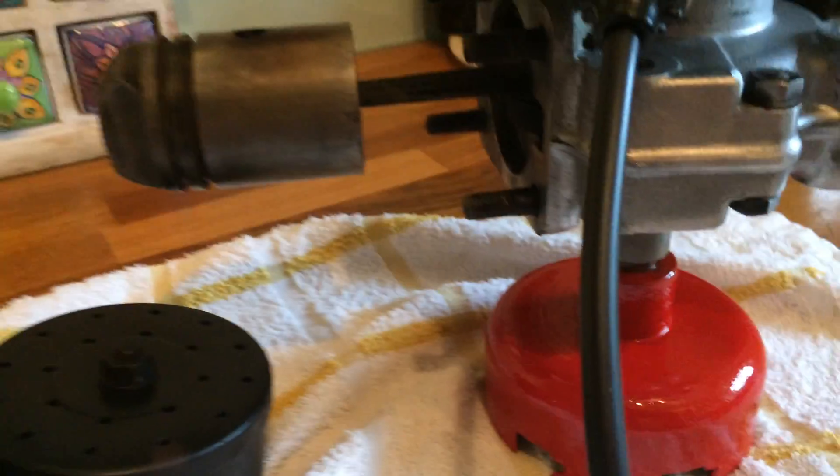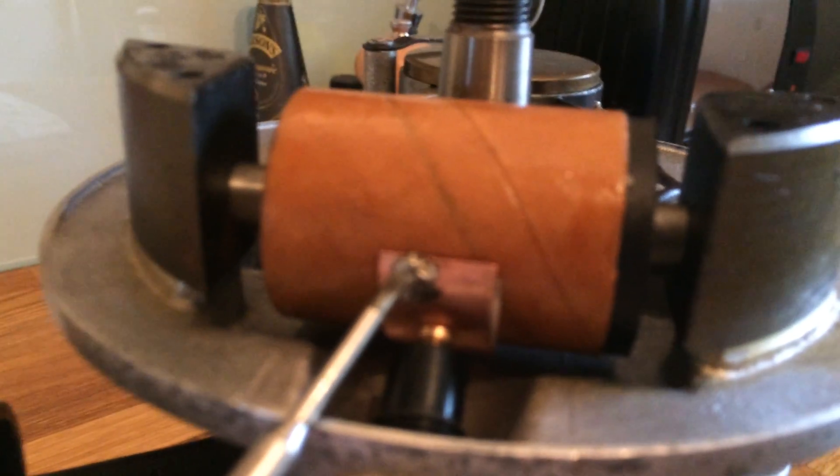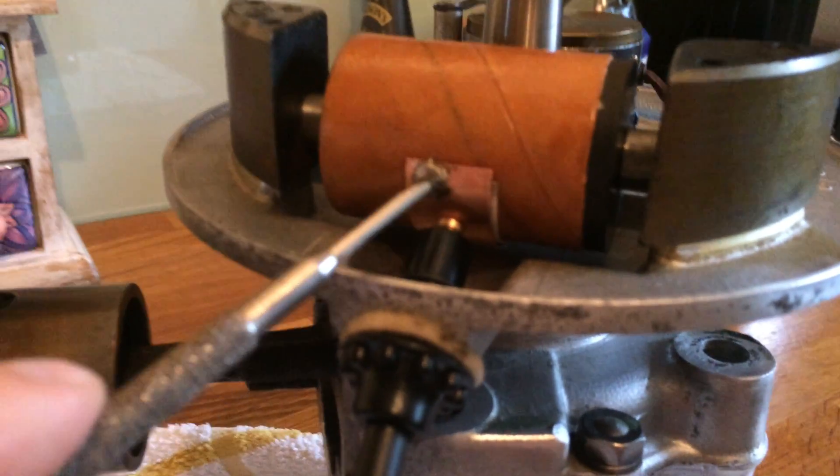So what I did — following NPMack's approach — is get a little piece of copper strip, which I bought off eBay, cut a little piece off and shaped it round. I actually punched a hole in the top part of the copper — it's like a little tab with a hole in it that sticks out. I located the copper over that, made sure it was long enough so the contact will hit and touch it, then soldered it gently on there.